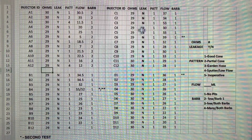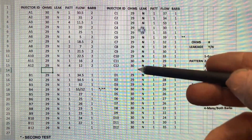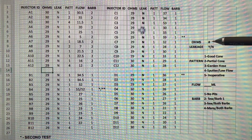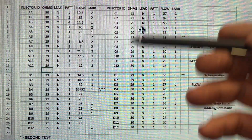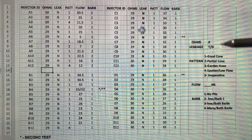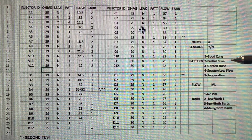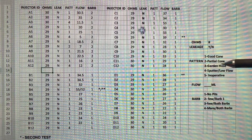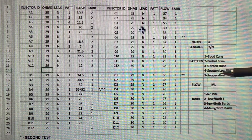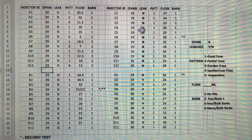Easy peasy. Let's take a look at the sheet where I recorded the information. We've got sets 1 through 12 labeled A, B, C, and D. The criteria I'm using: ohms or resistance will be a number in ohms; the leakage test is yes or no; for pattern we've got one through five — one is a good cone consistent over five to ten seconds, two is a partial or inconsistent cone, three is a coarse stream with no well-defined cone, four is sputter or low flow, and five is inoperative with virtually no flow at all.